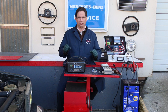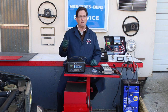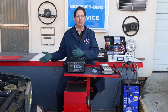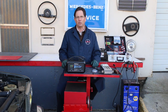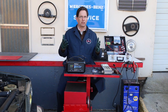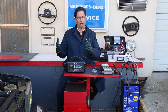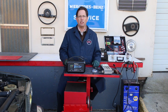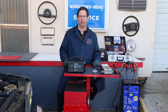Batteries can be dangerous — they're gassing off explosive gas, and you have to pay attention. And the problems go on and on. What do I do with this old battery? I think it's okay, but it's not okay. Do I throw it away, or do I try to put some super formula in it to resurrect it? And then you get into gel cell batteries or spiral wound batteries that are totally different, like the Optima. Their charge rates and maintenance have to be different. You can have some of these Optima batteries drain down, and if you don't charge them properly you'll think they're bad — and that's tough after you've paid $130 to $160 for one of these batteries.